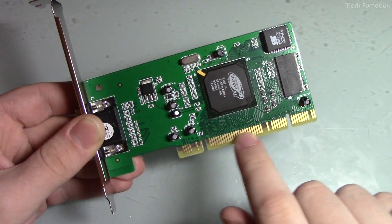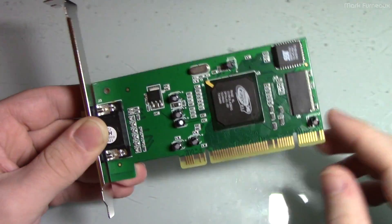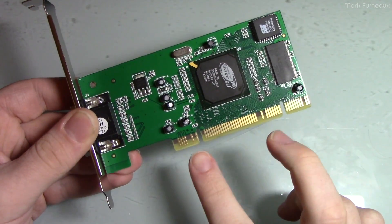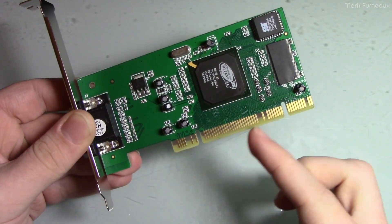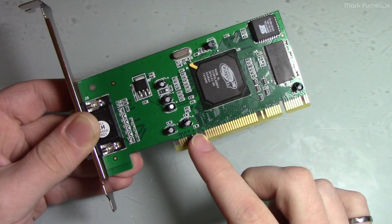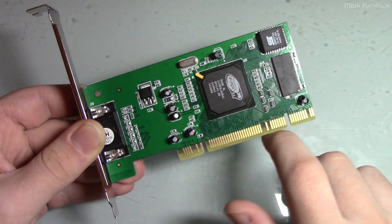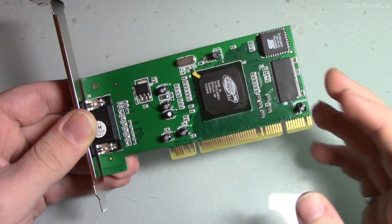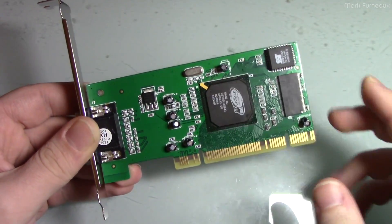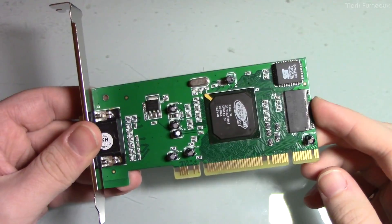The 5 volt pins are used — there is a capacitor on the 5 volt rail because this ROM chip is 5 volts — but everything else is 3.3. So you need a slot that can deliver both voltages. If you know anything about PCI, these two slots cut here in the edge connector are important: this one is for 5 volts, and this one is for 3.3 volts. If you had a card that was 5 volts only, you would not populate this slot. Where you have both is called the universal card, so because it has both slots it should be universal, it should work in my 5 volt slot — but it doesn't, because this is a hacky way to do things so they don't have to put two separate regulators on here to save a couple cents.